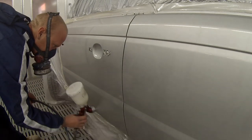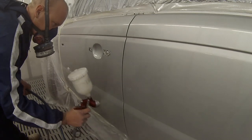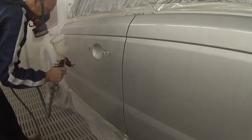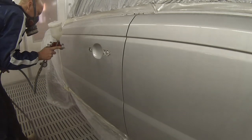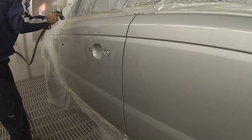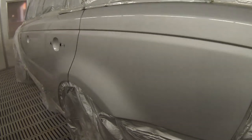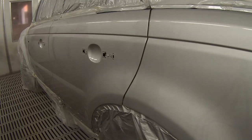Here we go for our second coat of clear. I'm probably going a little bit slower but still nice and close. As you can see these are quite efficient spray guns. I've actually had a look at some other videos on YouTube and their setups may not be 100% correct because they've got their pressure cranked right up and there's probably more overspray ending up in the air than what's actually landing on the panel. For this job it's just the two doors, a quarter panel, and the rear bumper bar. For clear coat I've mixed up about 600 to 700 mils, which is quite efficient when you look at the amount of panels I've actually painted.